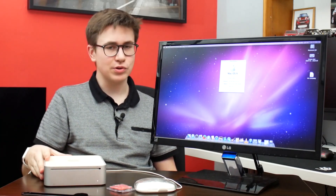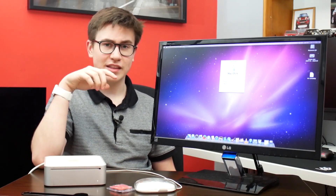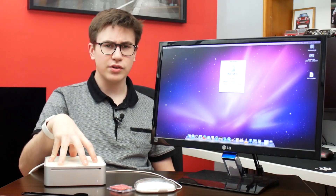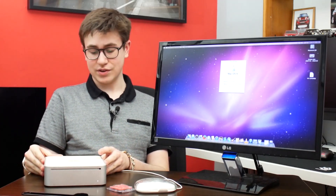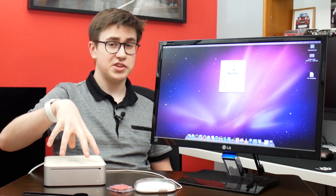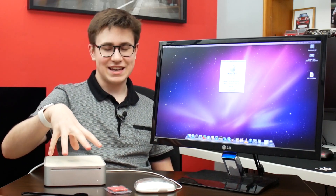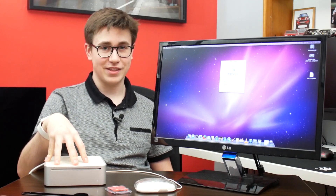We're going to have to get out the good old putty knife and open another Mac Mini. A notable upgrade I should mention that the previous owner did do to this machine was upgrading from the stock 512 MB sticks to 2 GB of RAM. So we don't really have to worry about RAM. Obviously I would like 4 GB in the future, but 2 GB is going to be fine for now. Also, an SSD is going to make a world of difference for this machine.